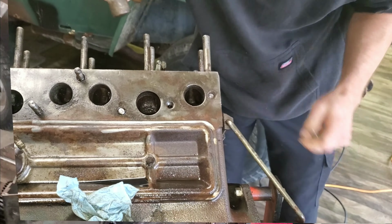All right, so what Kyle has done, basically, is... there we go. There was a nice sharp edge that I couldn't quite get with the chisel, and he eliminated that. It did a little dimple in the center, which should help our drill bit not walk, to get a nice center to start, and that's what we're going to do next. Wish me luck.